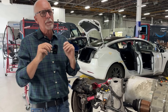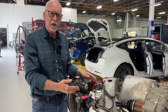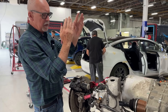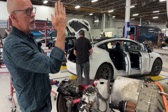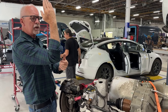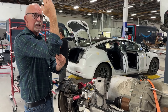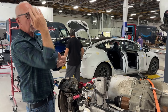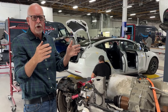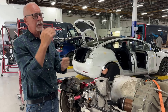There's a third component in suspension called caster. Caster is not adjustable on the rear end of a vehicle. Caster is essentially — if we're looking down the side of a vehicle at, say, the passenger-side front tire — the angle between the top of suspension travel and the center of the wheel, either laid back or standing straight up and down. Caster helps a car recover and go straight, especially over bumps. If you have a caster problem and hit a bump, the car gets squirrelly.